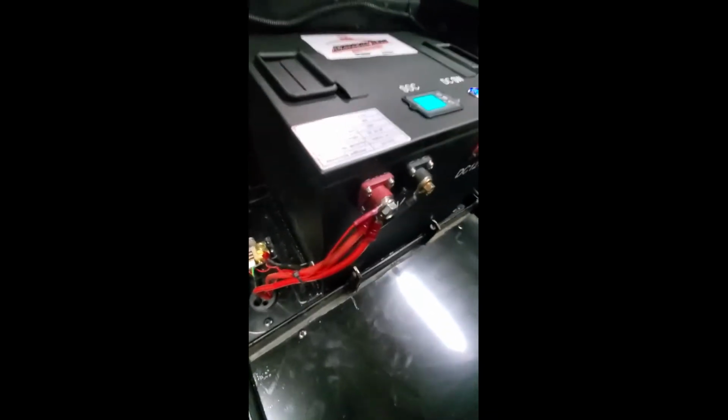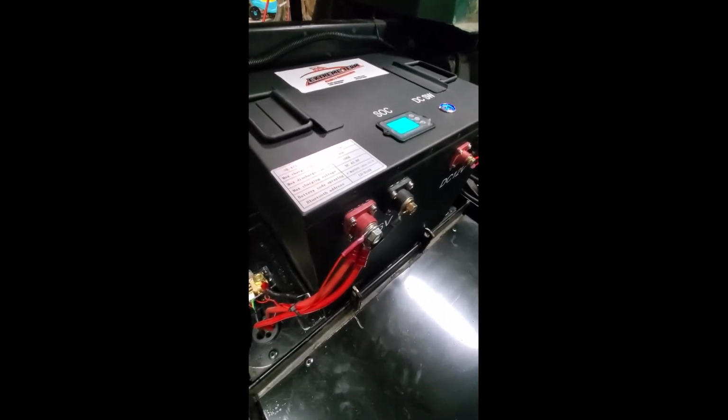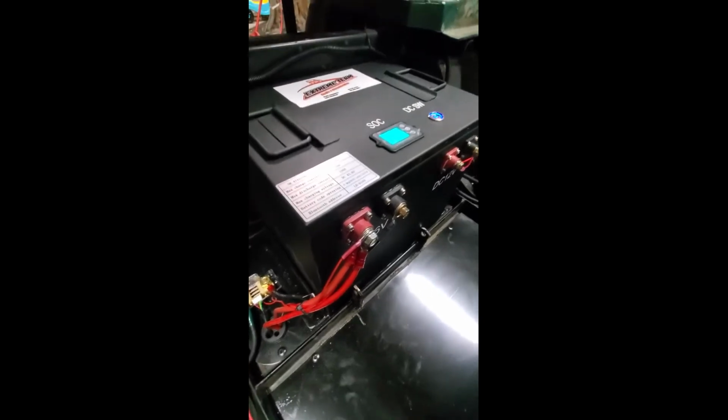On the other end of the charger, you're going to take your hot wire and run it over to the hot side of the 48 volt circuit. Now your ground wire is going to be a little bit different coming off the charger. The ground is actually going to go into this shunt. And this shunt is on here for the digital dash gauge that we also supply.